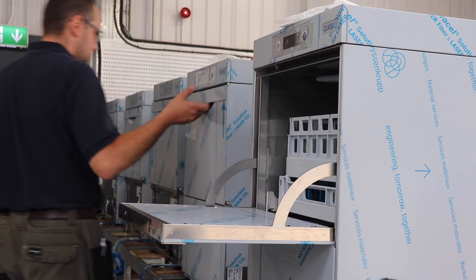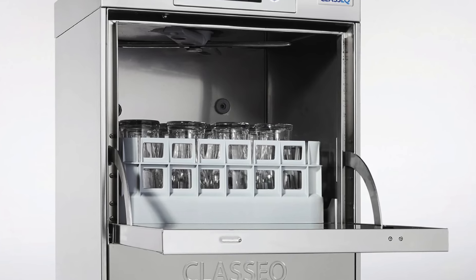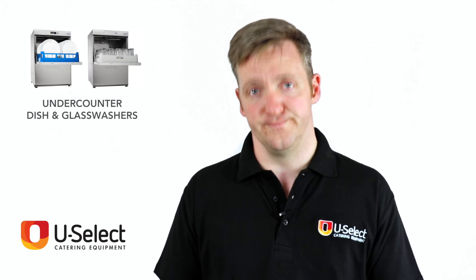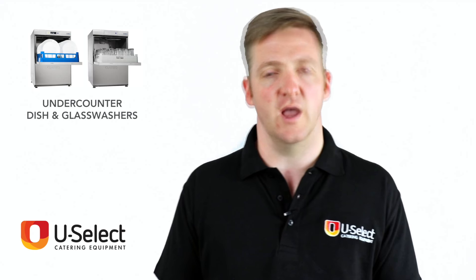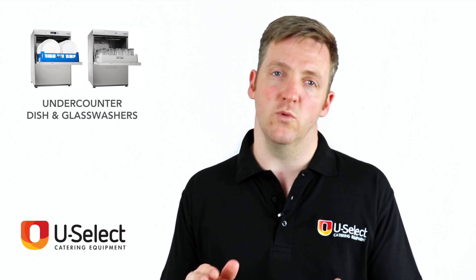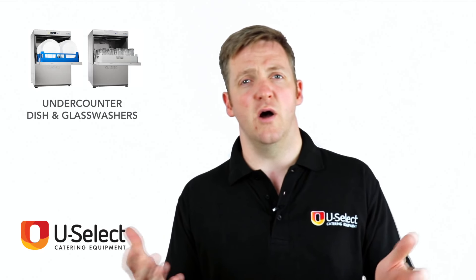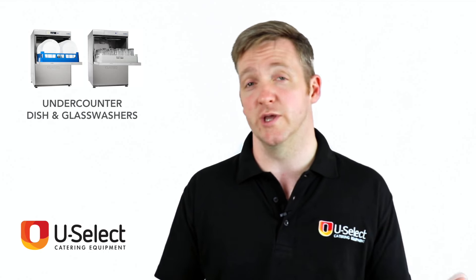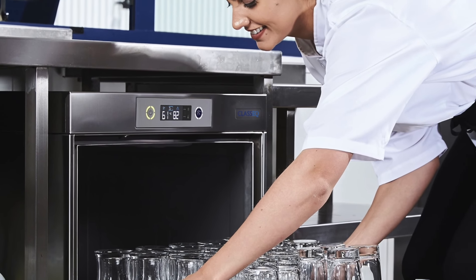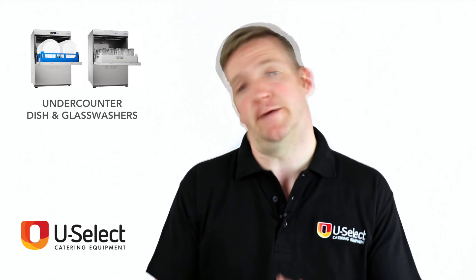The duo is Classique's more premium range with a lot more features. They're called the duo because they're double-skinned, meaning they have a double lining around the wash area. This does two things: it makes it quieter and more efficient because it loses less heat, so the element inside doesn't have to work as hard to keep the water warm. The duo all come with a drain pump, and there are versions you can buy which also have an integral water softener — so just as with the standard, check if you need one. Because it has an integral drain pump, you don't need to worry about where you place it. It's just as simple to use — you can just plug it in, press go and you're ready. But it also has an LCD readout which lets you see how hot the water is inside and where it is in the cycle. It's still very easy to use, not scary at all, and a great piece of kit.